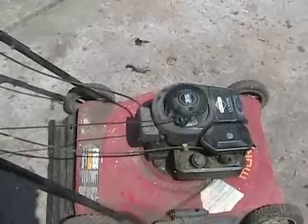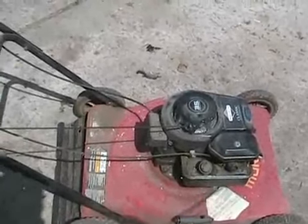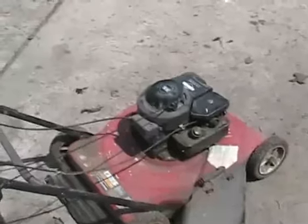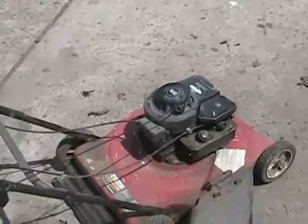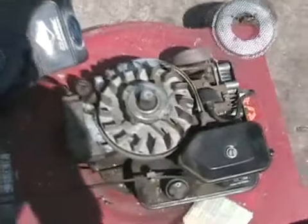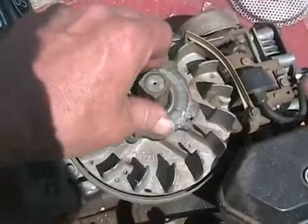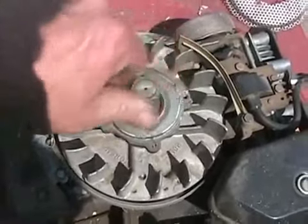So next step is to first see if he's wrecked the engine. Pull the string. Compression feels normal, so the engine's not wrecked. So I'll check the flywheel key now. Now that I've got all the peripherals removed, I have to remove the ratchet that releases when you start it. Turns one way and ratchets the other way.